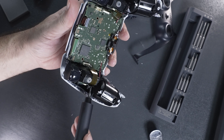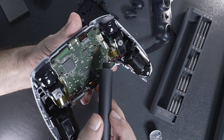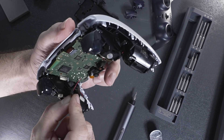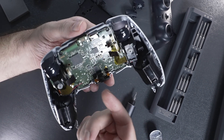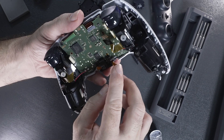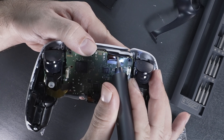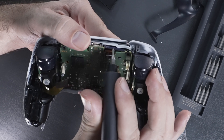To take the whole piece out and get to the joysticks, there are two more screws — one here and one here. Now we have to unplug quite a few things. There are two ribbon cables on each side for the trigger feedbacks — just pull on the little tabs and pull out the connector. Be very careful as everything is quite small and fragile; you can use tweezers. There's another one down here that goes underneath, and the last ribbon cable is a little more tricky — you kind of grab each tab on each side and push it out as it slides out.